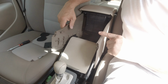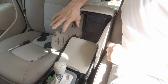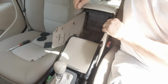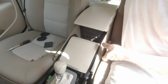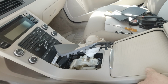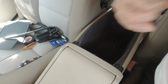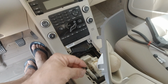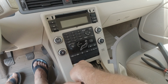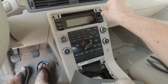Now this rear part, you remember when you want to put back the rear of this center console, you have to slide these four clips to here and to here into the middle of the center console to be sure to lock everything. Voila. So now I can put back all the screws. Two here with the plastic cover, six inside. The screws here. There are two more here. And these two fit here.